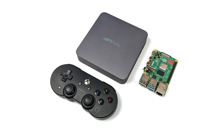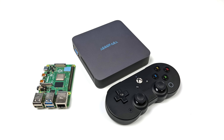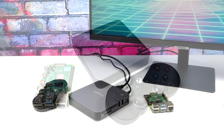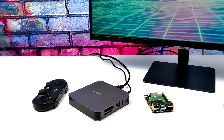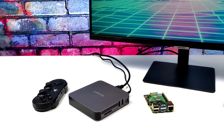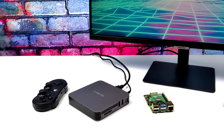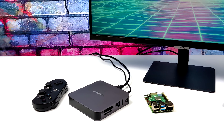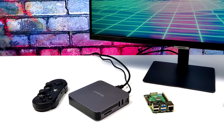Overall, really enjoying this little PC. You'll find a ton of these new Celeron CPUs — the N5105 — in a lot of mini PCs on Amazon and eBay nowadays. One thing you really need to look for is make sure it's running dual channel RAM; that's really going to help out with the GPU. I would stay away from mini PCs using the N5095 — it's just not as powerful, at least on the GPU side. CPU performance is right on par, but if you want to do any gaming or emulation, you definitely want those extra execution units. With the price of the Raspberry Pi nowadays for retro gaming, this actually might be a good option. We do have more power than the Raspberry Pi 4, and right now if you were to go out and buy an 8GB Raspberry Pi, a decently sized microSD card, power supply, and a mini HDMI cable, this is only going to come in around 30 more dollars and it's definitely worth that extra performance. You can run Windows 10, Windows 11, basically any variant of Linux as long as it supports an x86 CPU, and we also have something like Batocera or RetroPie x86, so you can turn this into a really nice little retro gaming setup.